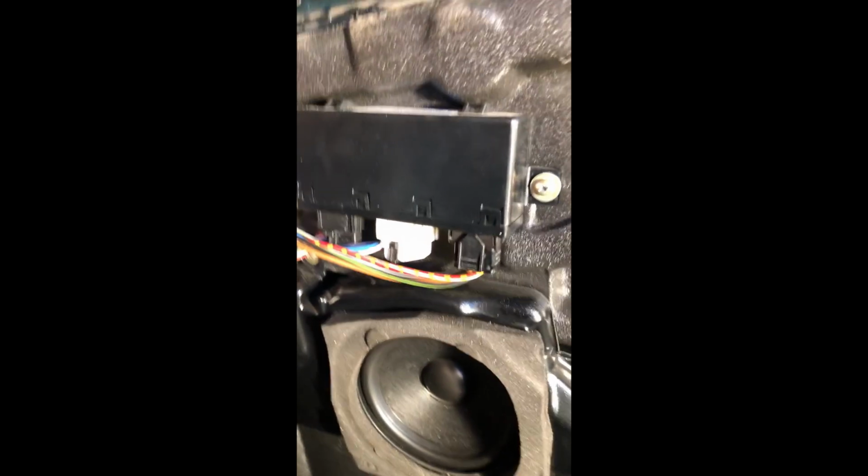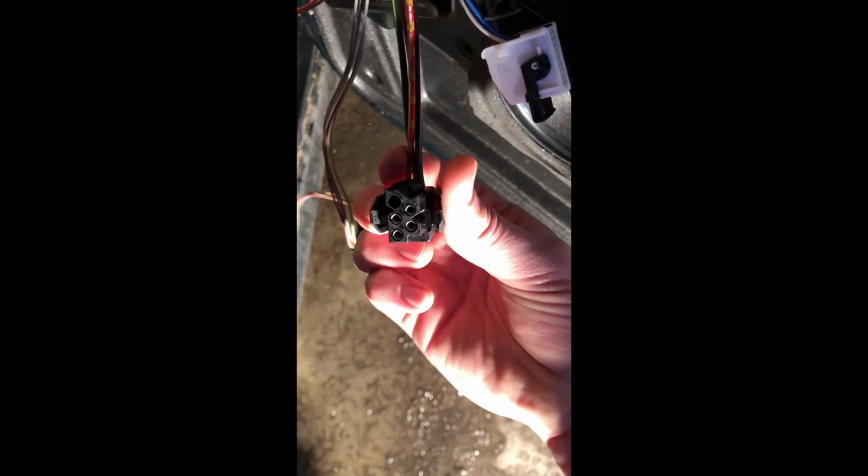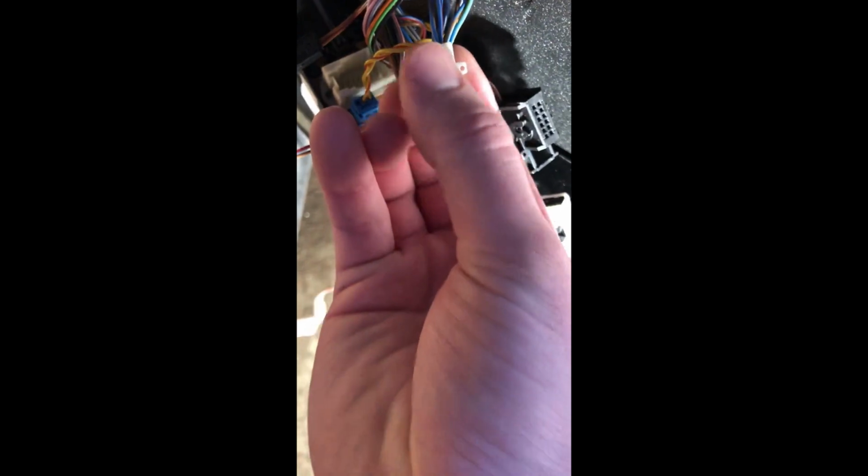So I'm going to go ahead and start removing that. Passenger side door module out. Super simple. On the top, you'll press on this little tab and release it. This one, super simple. Press the two tabs, pull, and where's the other one? This one. Same concept. You'll press the tab right here and pull this. It's all the same concept. So, all right, that's undone now. The next process would be to figure out how to get to the mirror and start with that.